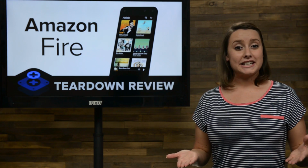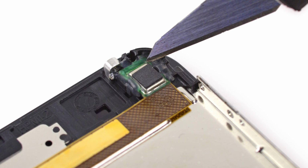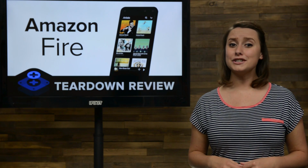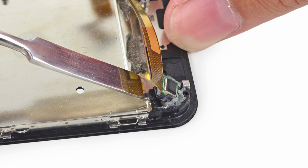Much like the Xbox Kinect, the Amazon Fire Phone uses the LEDs to blast out infrared light that the 4 dynamic perspective cameras interpret to create the dynamic perspective effects. Speaking of those dynamic perspective cameras, we found them thoroughly glued in place right below that cable. These cameras require careful calibration, and it looks like Amazon isn't taking any chances with them slipping out of place, which means for us to remove them, we're gonna have to do some serious prying.